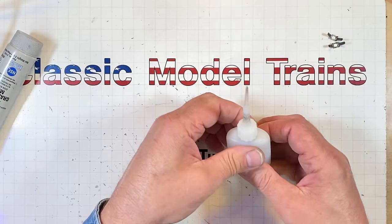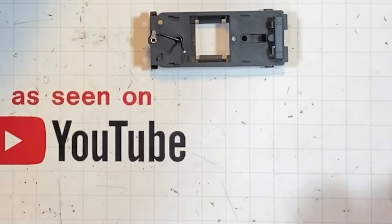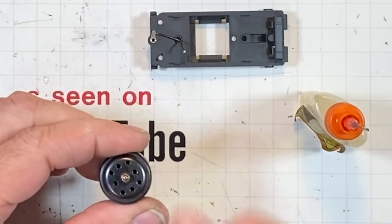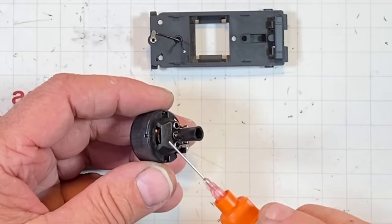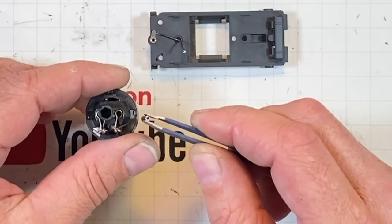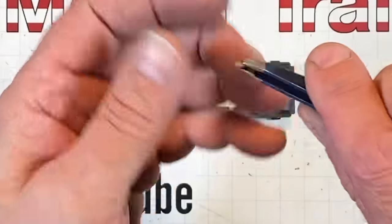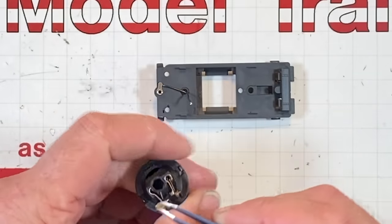Now we can start putting it back together. We'll give the motor just a tiny drop of oil right down here and a little peck up in here - because too much oil will get down onto the commutator and foul out the brushes. I soaked the brushes in odorless mineral spirits and wiped with a Q-tip. The real brush goes over on this side, and this one here is the screen - the side that rubs against the commutator doing its scraping magic.